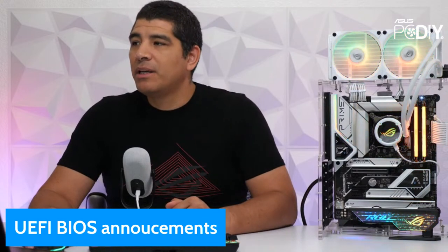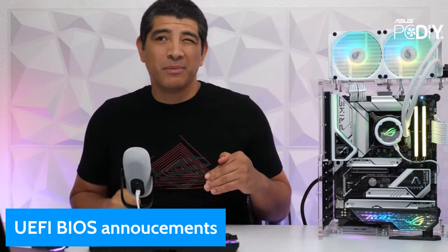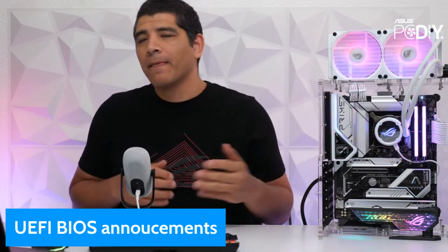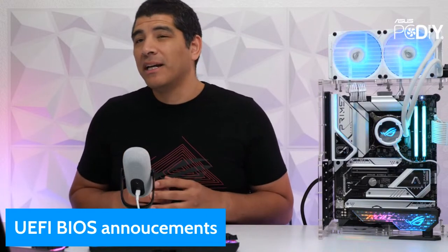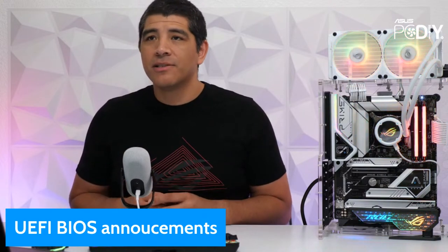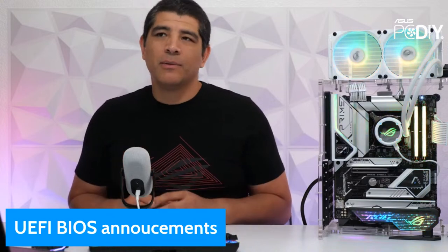But if you do want to see if you can get a little bit more improvement, if maybe you're coming from a build more than 6 months ago, then there could be some reason to update to this newer build to see if you get a little bit more tuning margin, maybe in terms of DDR5 scaling support, or certain DIMM configurations. So there is some tuning that we've done in terms of microcode.